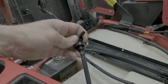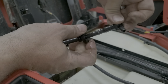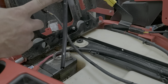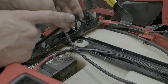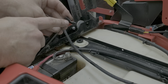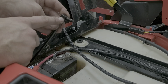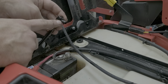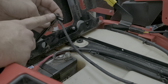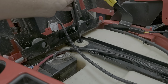On all of them you'll have a grommet and then the actual plastic piece. Slide the grommet off — when putting it back in, put the grommet in first and then insert this back down through. Usually it gets clogged right up here. It's pulling in fuel from the bottom, and right where it goes to a smaller inside diameter, usually a stick or a little twig will get caught in there and plug it up. It won't restrict flow at first, but when you're running for a long period of time it will restrict it enough that you'll literally just run out of gas.